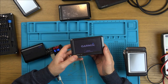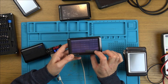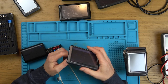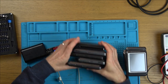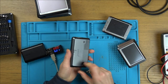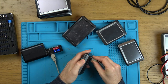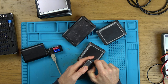One also asked me to go to a secure location. There we go - enter pin. Invalid pin. Move into your security location will automatically unlock the device, so I'm not going to know where that is. All of these here have some kind of pin issue or there's a picture of a computer with a cable coming out of it. I don't actually know whether they're going to be fixable or not. But maybe I might be able to take the ports out of here and put them into here. None of them are drawing anything, and that port is definitely faulty - look at it, properly wiggly.